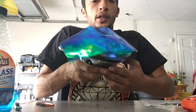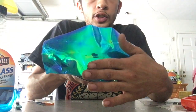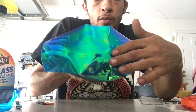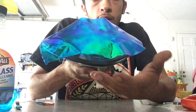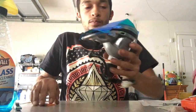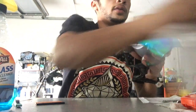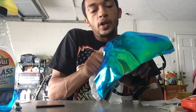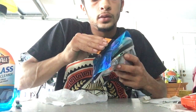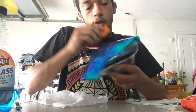Try to get these air bubbles out — you can see how it's wrapped. The bottom just needs to go down underneath more. With the heat gun we'll heat the sides and it will kind of melt and bend, and with your hand you just move it back and it sticks. Keep doing this, taking all the air bubbles out and making sure it's sticking underneath. You don't want to be driving down the road and have your film start coming off.